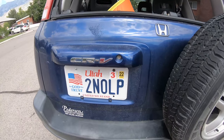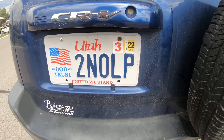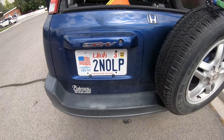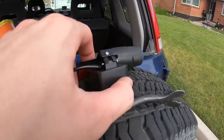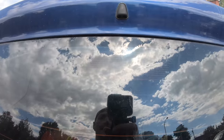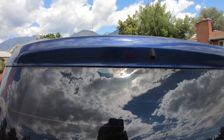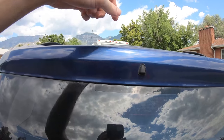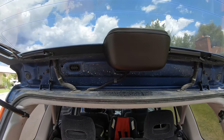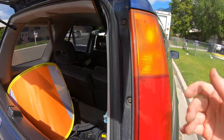Alright, so plan C. I had it sitting right here but it was covering up the numbers on the license plate, which obviously you can't do. I'd wager a guess it probably would not cause an issue, but if my wife passes a cop who decides to enforce that law, I'll get her pulled over. So what I'm going to do is test the adhesiveness on the back of this and smack it up here beside this brake light — there's a brake light right there. I'll put it right there, keep it out of the way of that windshield wiper. And I'm going to run the wire right back through here, under here, and just zip tie it to something so it's secure. This is the weatherproofing seal here, so behind here no worries — you can tape it down or do whatever. And then this is how the light is taken out, so we'll just pop this light loose real quick, wired into that reverse light, and in theory it should be good to go.